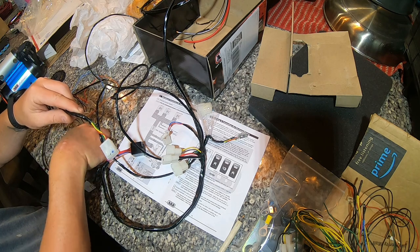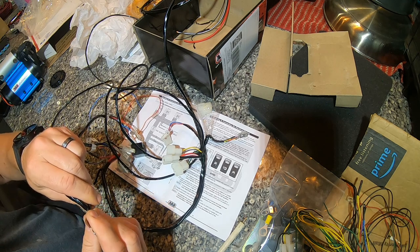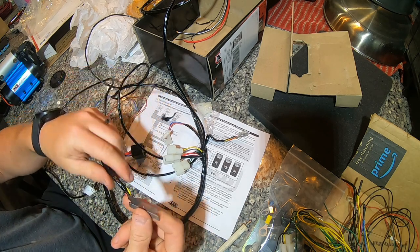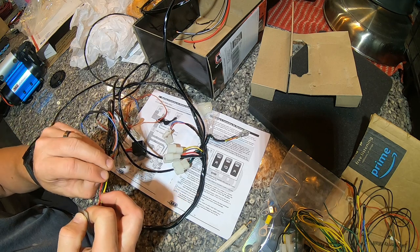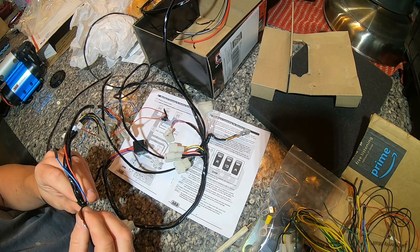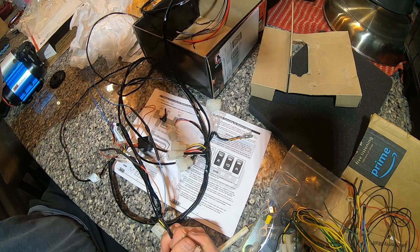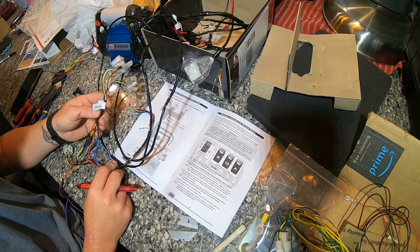The way I like to do this — one of two ways — is to grab a razor blade and put it right at the line where you can see the wires are going, and run it up a little bit. Sometimes the type of razor blade makes a difference. I like the flat blade or the slender ones like what comes on a regular razor blade. I don't really like using the holders; it seems easier for me to work by hand up close in that area so I can be more fine-tuned on what I'm cutting.